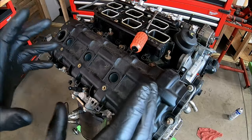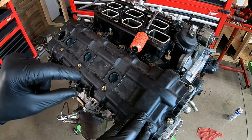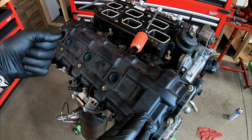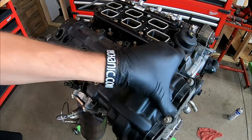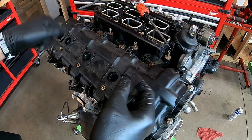On the right side, the main thing to pay attention to is when you go to lift up, there's going to be something stopping you at the rear. That's because where that PCV valve went on, that part of the cam actually protrudes through that opening slightly on the end, so it's going to hit coming straight up. Again, we're going to break it loose because of the RTV in the corners. When you pick up, you're going to pick up slightly, go back a little bit, and then clear that camshaft.